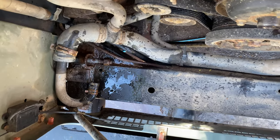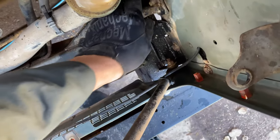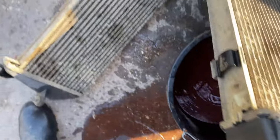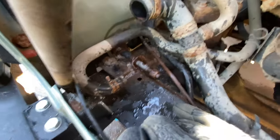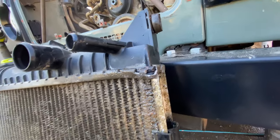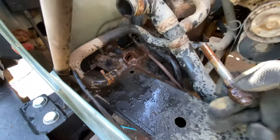I've just removed the intercooler and the radiator — these are all the hoses that are left. It's pretty empty and pretty filthy now, but actually a good chance to clean up the front of the car. Here they are: this is the radiator, and this is the intercooler. Interestingly, I haven't owned this car from new, and as you can see on here — 31st of the 10th, 2006 — that's when this intercooler was made, so it's 14 years old. What I was originally looking for was that bolt I banged through, and as you can see it came straight through and cracked into the radiator, which started all this mess. You can see where it's gone through just there — it just pushed the radiator open a little bit, and that's where it was leaking from. The culprit bolt is just here. Finally we can get it out — that's what broke my radiator.